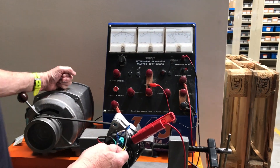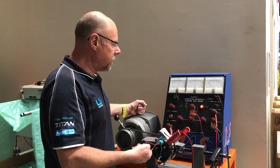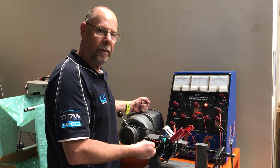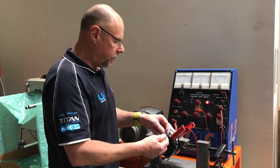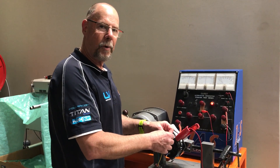So that's a couple of the common things that we get. Our customers fit a new alternator, ring us up and say it's charging but we've got a warning light on — what could be possibly wrong? Well, it's not an alternator issue. It depends on that ignition feed and that battery supply. Okay, thanks for watching, hope that helps.